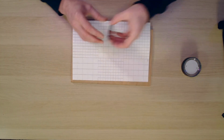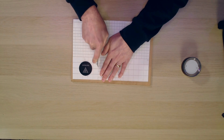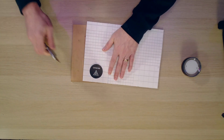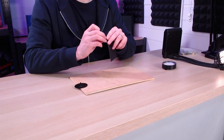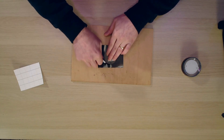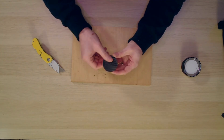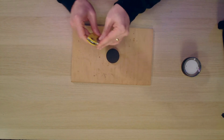For the vinyl, I'm using a cutting disc as a template — place it over the vinyl and cut along the lines to avoid waste. It doesn't really matter which way around the vinyl goes because it's a carbon print and it'll look good either way. Peel it off and stick it down on top of the disc. Then run a knife all the way around the edge and it should trim off perfectly for the circle. After trimming, we have just a carbon print on top of the disc. It's a pretty clean cut using a Stanley knife — that worked really, really well.